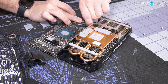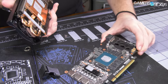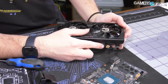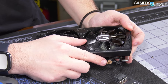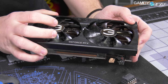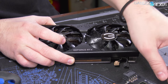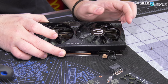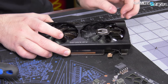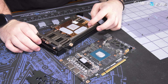Very simple card. I actually really like this — it's such a small feature. A lot of the time, the fan headers for video cards don't have these clips on them. These clips, you can just push and they'll release from the housing like you'd expect. But a lot of video cards have those really form-fitting connectors and headers, and the end result is that you really need to be careful removing them because you can rip the wires out very easily. So these are better done than a lot of the ones we've seen — a small positive, but one that makes it easier to repair things.